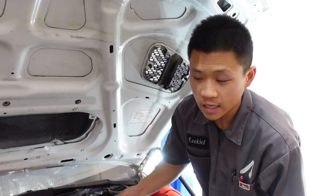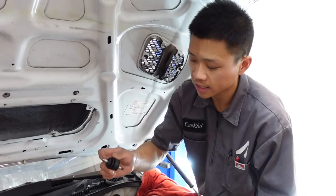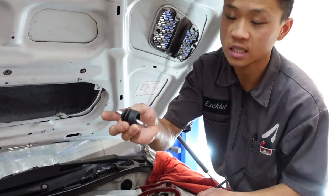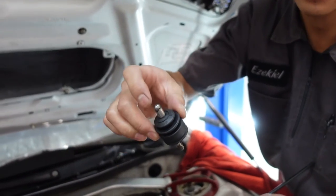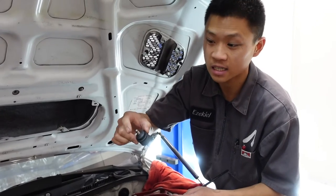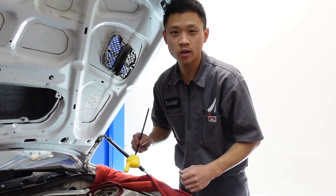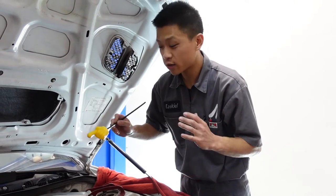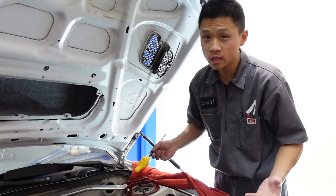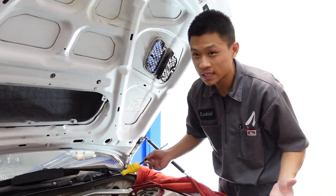One other key thing that's not really part of bleeding the clutch: once you are ready to go back together, this pin — you should actually put some heavier grease on both sides of these pins. I've seen these completely wear out or flatten out on the edge, and that's actually reducing the throw of your clutch. So if you're having trouble bleeding your clutch on your STI, make sure you're doing it the service manual way: take the slave off, move it to the highest position. If fluid's not moving, maybe your clutch master cylinder went bad. I don't know why this happens, but it does.